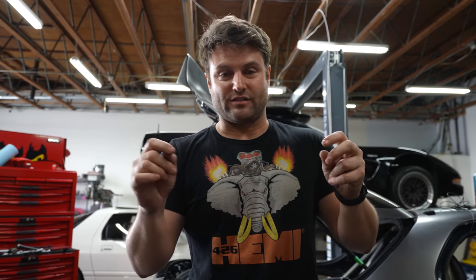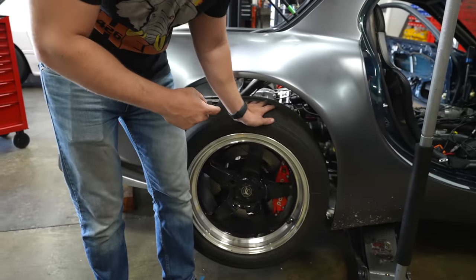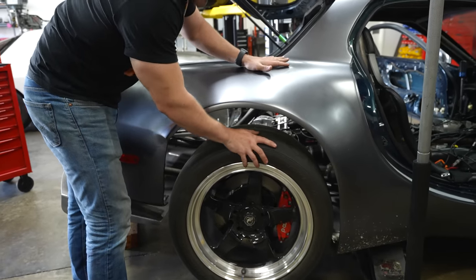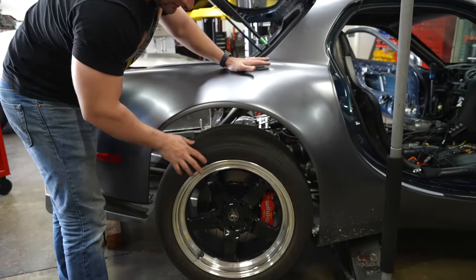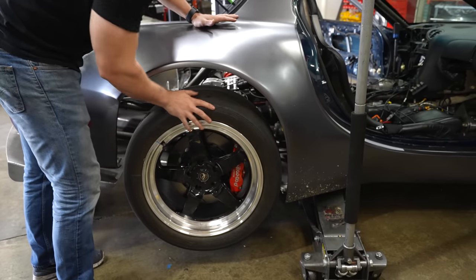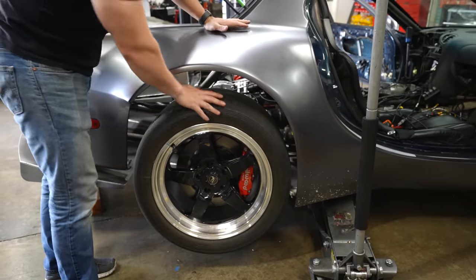I've hacked, and it really feels like a hack because there's no information on it, and I feel like hacking is a gaining information type of phrase. I have hacked the Corvette 01 06 wheel hubs ABS sensor. This is called an active ABS sensor, and I've wired it and I've got it working right. I simply put a test that as soon as that ABS sensor senses over 5 miles per hour, and I haven't calibrated them yet, whatever that is in terms of rotational speed, I have the all-wheel drive system kicking in and counteracting the wheel spin.